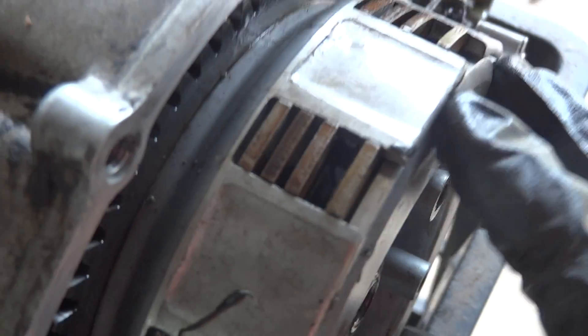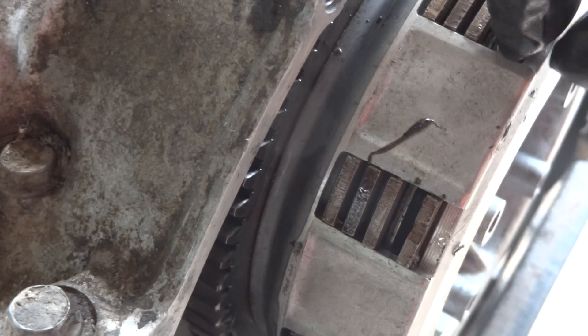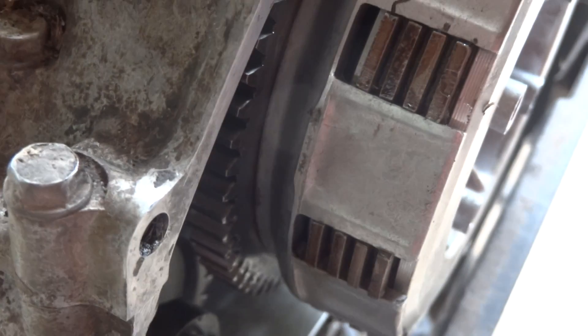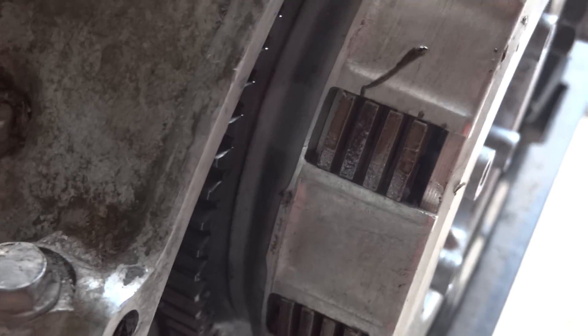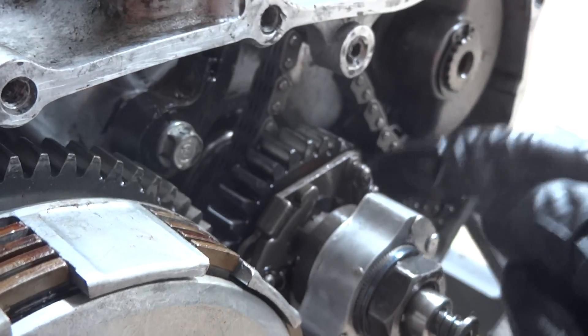All the silver ones in between are connected to the drive shaft from the engine. Now you can see that there's a lot of space in between them — you can move them apart. When all the springs were on and that was pressurized they were held together, and these are made of friction material kind of like you'd find on a brake pad. Each one connected to the drive shaft from this side, and all these ones are connected to this clutch housing — you can see they're notched in here.